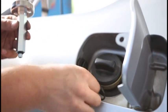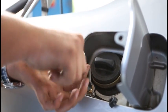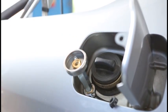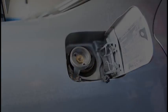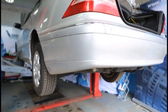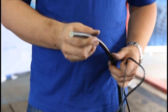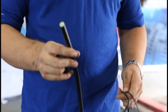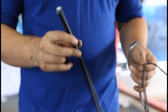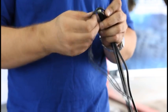This is the filling point. To fill the gas, we take off the cap. We screw in the filling valve and we may start filling the gas. We will use thermoplastic pipe to connect reducers with the tank. We provide gas level indication wires and electrovalve power supply line, together with copper or thermoplastic pipe.